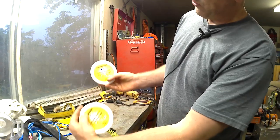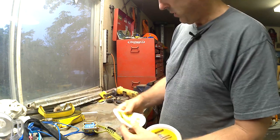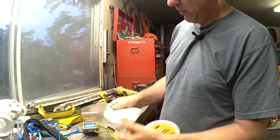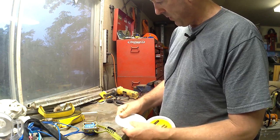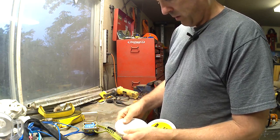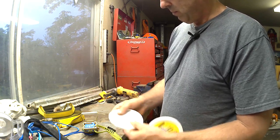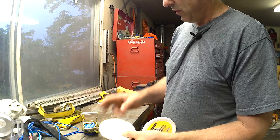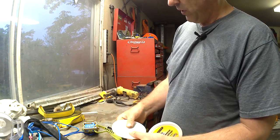The synthetic winch cable was in danger of fraying on the side, so I wanted to put a spacer in there that would allow it to slip by. This is my first attempt and I'm leaving it in here just because it's a thorough showing of how I did it. Later on you'll see I replace it with some tougher plastic because this stuff did not hold up at all to the first pull I did.